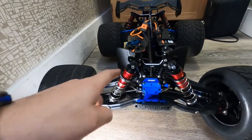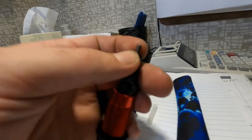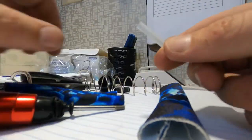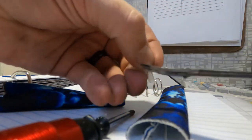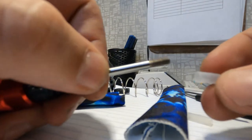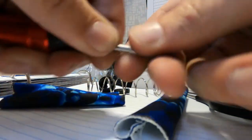The way that you fix it is you have to pull the shock apart. I'm going to show you exactly how we need to do this. You've taken your shock apart — you need to slide that boot back and pull that shaft out. Then you take your tubing or your hard piece. We want about half of this — I don't really think I need that much. About that much. Take your tube and put it on.